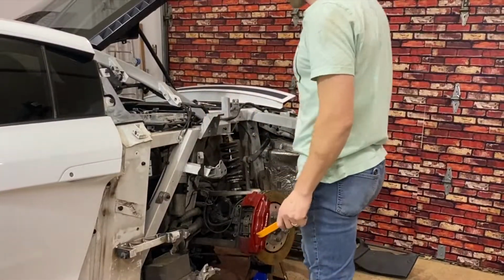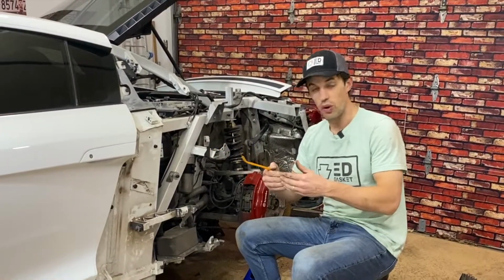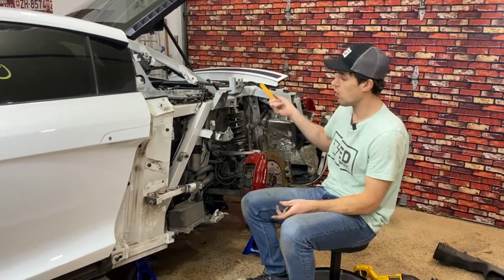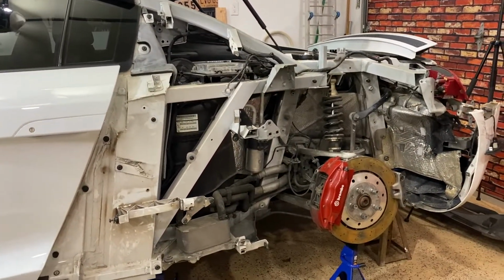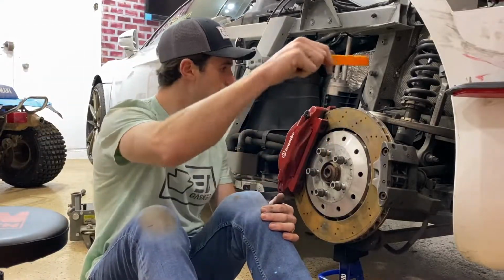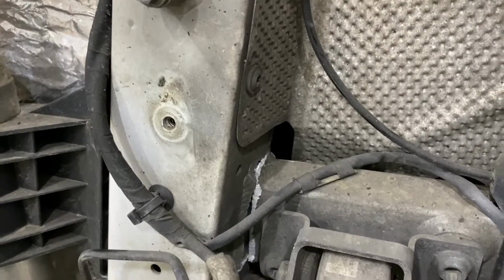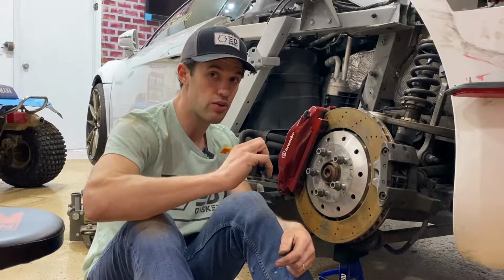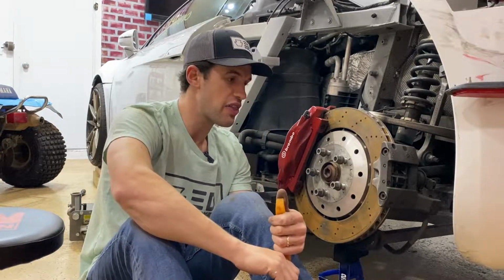Alright, well, that was a little overwhelming. A lot of nuts and bolts hold this thing together, but it's nice that it's not welded together like a traditional car. So really just a whole bunch of Torx bolts and this thing came all apart, giving us great access to this damaged area where we can see the crossmember is completely beyond repair. So I'm thinking we'll keep the suspension together for now. I can see exactly what I need to order in terms of parts that need to be replaced, but it might be best if we can put a wheel back on this and then take it to somebody who knows how to weld better than I do, because that crossmember is gonna need the skill of a more practiced hand, and I think I know just the person.